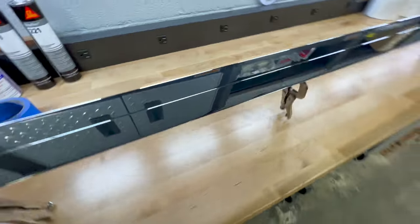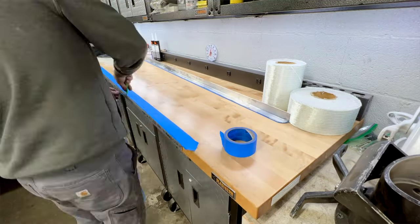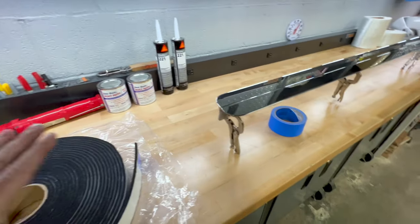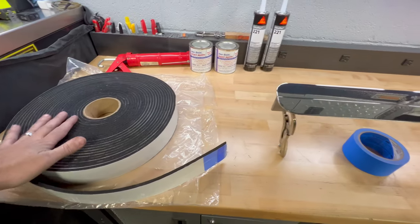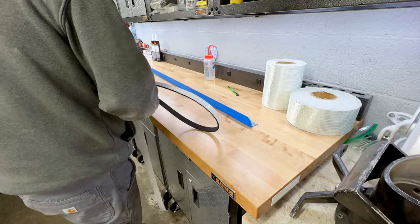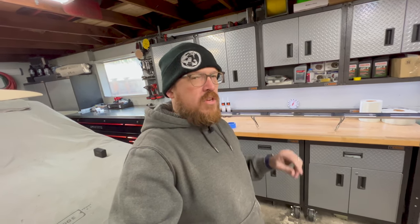The angles came out really nice — they're going to look good in the boat. I'm going to lay blue painter's tape over the face of them to preserve the finish while I continue working on the rest of the boat. In addition, I ordered some oil-and-fuel-resistant foam with adhesive backing — I'll split the 2-inch wide foam and run a 1-inch wide strip on top of these angles as a cushion. The angles are not meant to hold the tanks tightly; they're just there to keep the tanks honest and prevent them from moving outward.